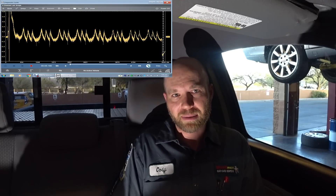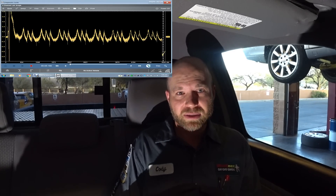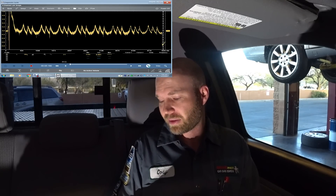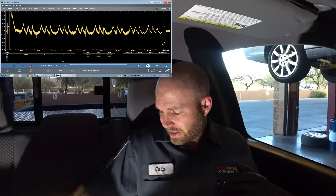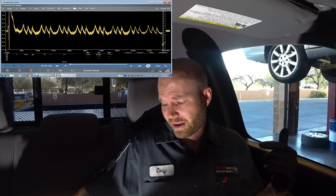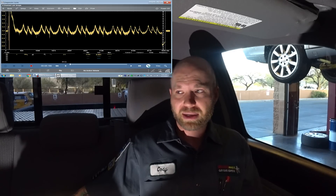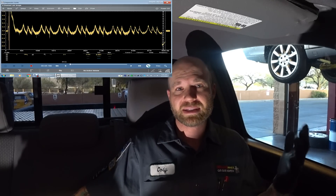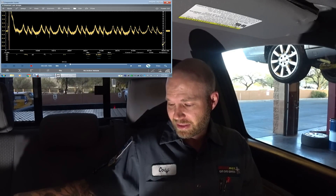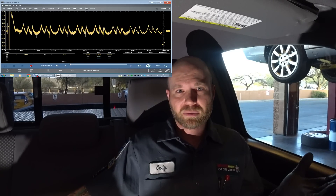If using voltage, I always like inverting my waveform — a little bit easier to understand. High compression means higher peaks; flip that around so compression shows as valleys. Every scope is going to be different, but on the snap-on I use a 2-volt scale, AC coupled, and inverted. Just remember with snap-on scopes, you won't see what you want live on the RC test — you need to stop it, zoom out, then take the capture to see the compression. Pico is obviously different.